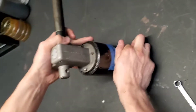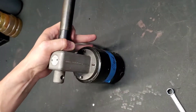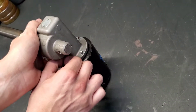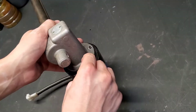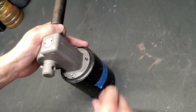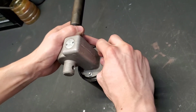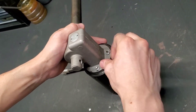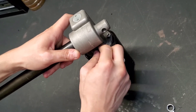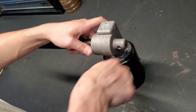Just like that. Now we're going to put back on these lock washers and nuts. If you'd like, you can omit that top nut and lock washer because the three on the bottom do the job, and that top one, as we saw earlier in the video, can become kind of a pain when you're trying to service the motor. We're just going to throw these back on and tighten them, and that's all there really is to it. The installation is the reverse of removal. Once you've got these tightened, you're good to go.